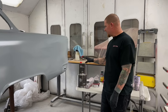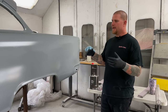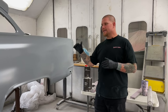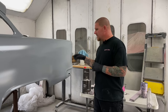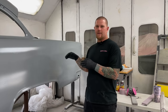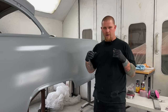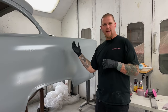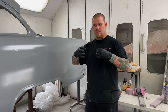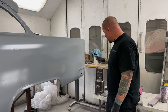The amount of time that you should wait to take this primer down with block sanding is anywhere between three days and five days. There have been guys like Colton Davidson that did shrinkage tests on this material and it's superior compared to some of the others like Sikkens. The big reason is you want to make sure this is completely dry and it's not going to soak up. This primer, like every other product, has solvents that have to escape. They have to have time to fully cure, and when they cure and they shrink, you don't want to start blocking the next day with everything looking laser straight, only to come back a week later fully dry. That thing will actually start to cure and shrink and your body work is no longer crisp — it'll start showing ripples and waves. That is just one of the main things to really think about with this product.